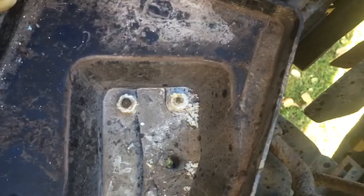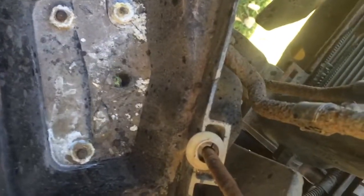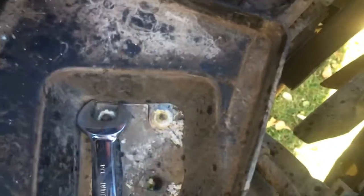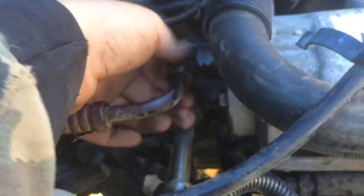Now we're at the stage of pulling the hoses off the radiator. This is three-quarters down here, down in there somewhere. This one was extremely tight — I'd already cracked it. I'm going to get it by hand now. I've got to throw the wrench back on now. We've got this dig nut up here — that was a 7/8. This one up here, right by your air compressor for your AC, also pops right out.